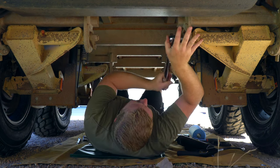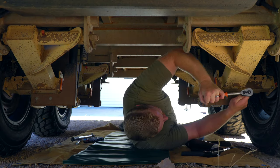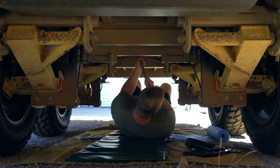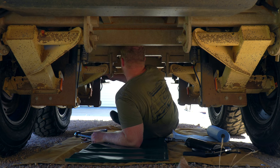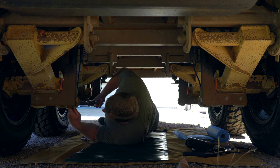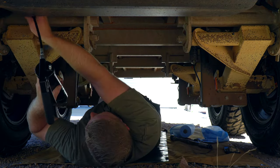I start with the large, high-torque pivot bolts on the front of each of the suspension arms — using a torque wrench is the best way to confirm the correct specification. Next up, I'm checking the two front-facing bolts on each of the shock guards. Onto what is probably the single hardest working component — the shock absorber. Back to using a torque wrench to confirm that both the lower and upper mounts are tensioned properly. I take a couple of minutes to thoroughly check over the shock absorber, confirming there's no physical damage to the body, the remote reservoir or the shaft, and ensuring there's no evidence of shock leaks, particularly at the bottom of each unit. I also check the lower cable strap mounts and upper mounts. There's a single grease point on the leading pivot point on each arm — using a general grease compound with lithium additives, we fill this up until grease is observed pushing out from the end bushes.